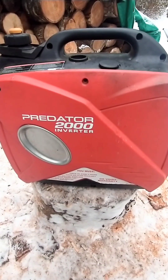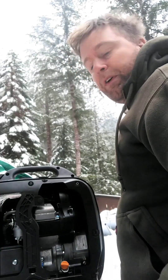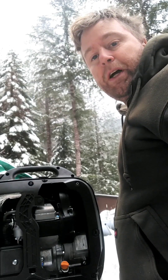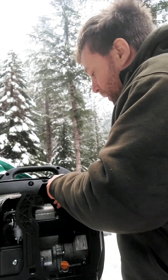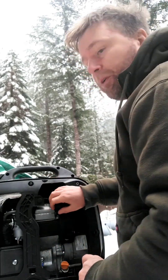Pop up the spark plug cover. I used a screwdriver to get under there. Next, remove the side panel by removing the three Phillips head screws on the top. With the cover off, take a flat bladed screwdriver and pry up the spark plug boot.